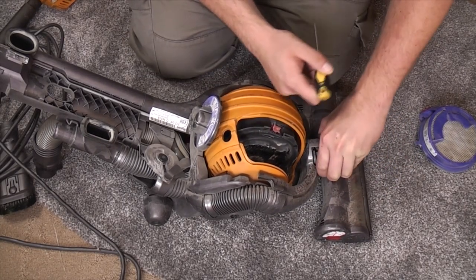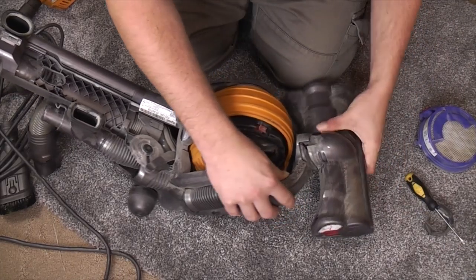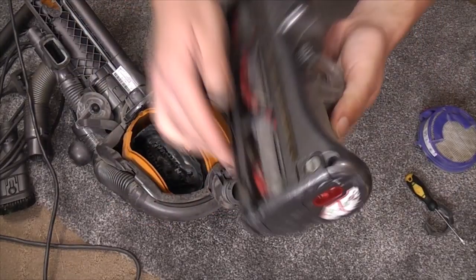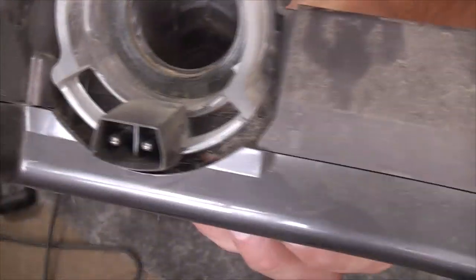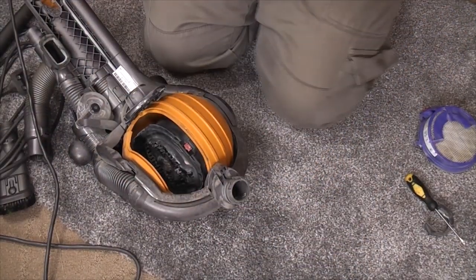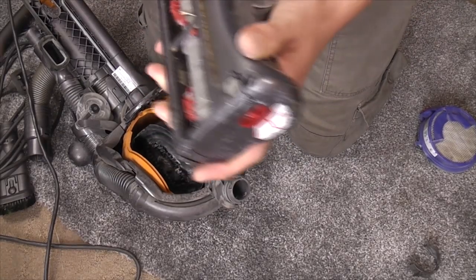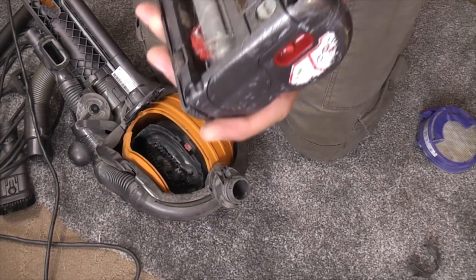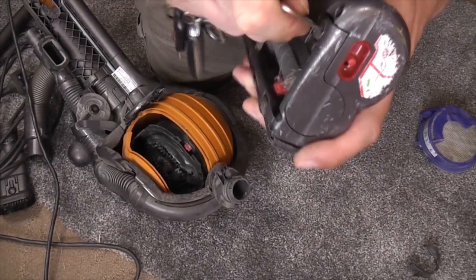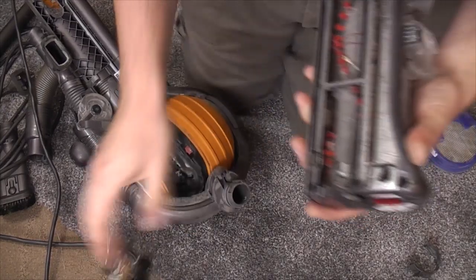We need to see, because that might have killed it. While we are down here, we shall remove the brush roll so I can show you it, because this is doing the usual thing of filling itself up with fluff, look, in all of its extremities. Don't know if this screwdriver is going to be big enough. No, it's not. Hang on. You need something wider so you don't chew up the little locking tab. Oh, turned it too far. There we go.